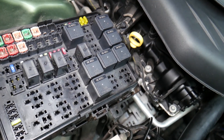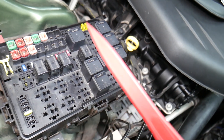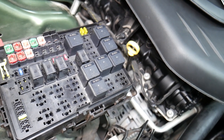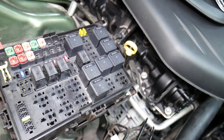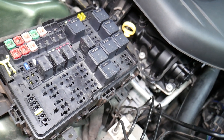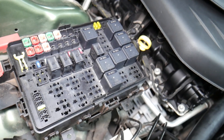We'll put a link in the description below on how to test relays. For some certain fuses, it's important to disconnect the car battery when removing them, otherwise you can burn the electronics. For instance, when working on airbag fuses, you need to wait at least one hour after disconnecting the car battery. If you're not qualified and certified to work on the airbag system, I never recommend doing that.